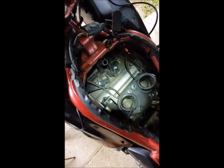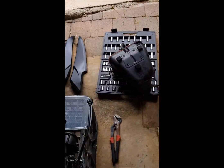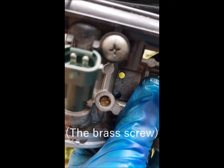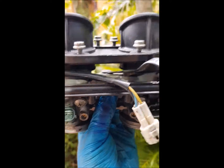Just to give you a little breakdown of that — attach your vacuum hoses there and there, and the idle screw adjustment, which I'll show you on this spare carburetor body that I've got. That's it there and there, so it's sitting like that.